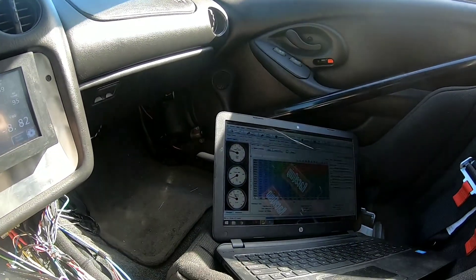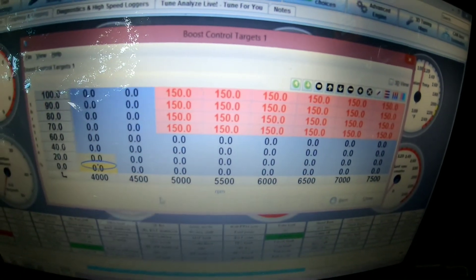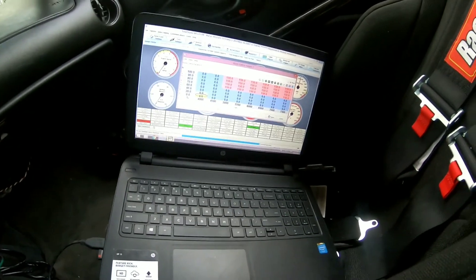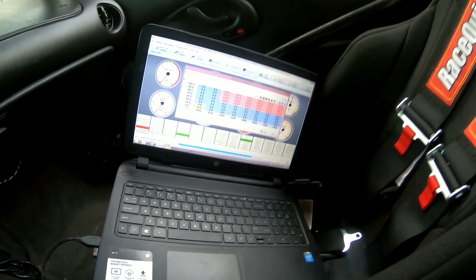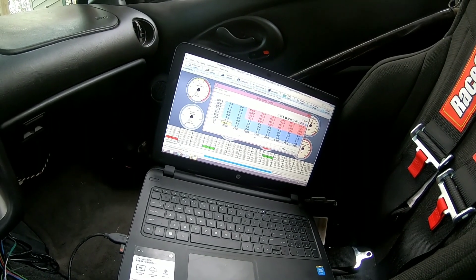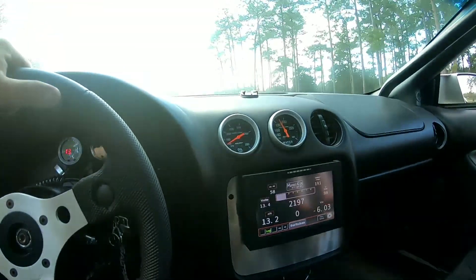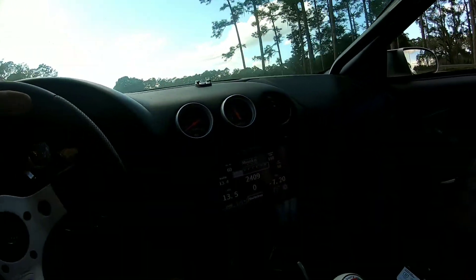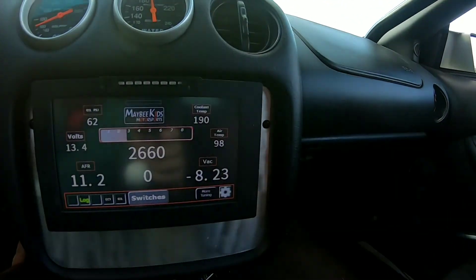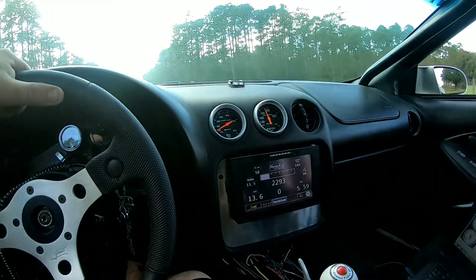Now I'm going to go in and add some CO2 on top of it and see if we can make some more power. We know it made seven to seven-and-a-half pounds, so I'm going to add 150 kPa to the dome, which is about eight pounds - so in theory it should make about 14-15 pounds of boost in the manifold. This run will be with 150 kPa on the dome, should give me about 15 pounds give or take.